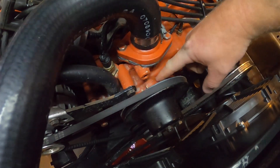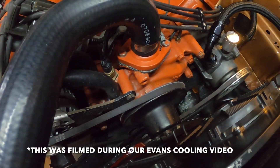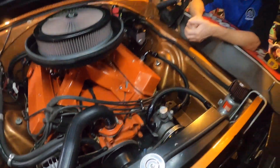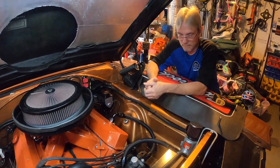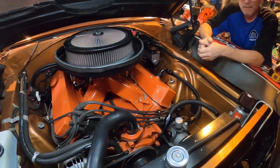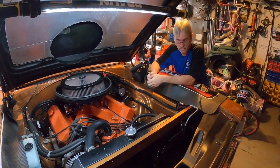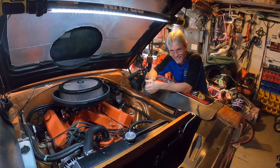As you can see, we're leaking here out of the thermostat, so we're gonna have to put a new gasket in and reseal that. Congratulations, welcome to aftermarket thermostat housings - I don't think I've ever had one not fit or at least not leak. Even if you put it on a belt sander and try to flatten it out, we tried three times and it didn't work. I'm gonna live with this little seat till I change all of it.